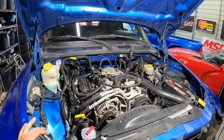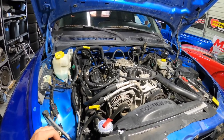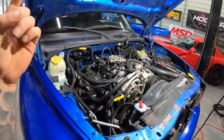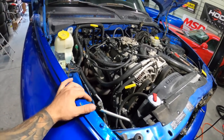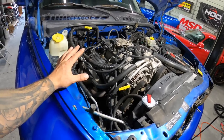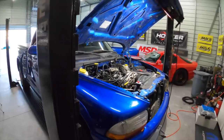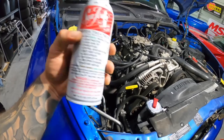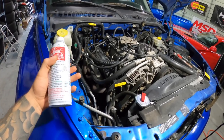We took off the inspection plate and the flex plate looked okay in the last episode — we were checking that to maybe see if there was a crack in it. I picked up a stethoscope and a boroscope. Since I had the valve covers off and ran the engine without them, I got a little bit of oil seepage, so I can't run it right now without making an absolute smoke show. I also picked up some Seafoam, so I'm going to run that through the engine before we drop the engine oil.